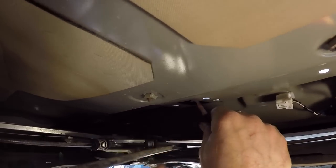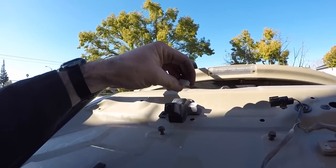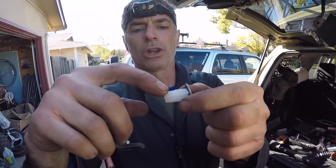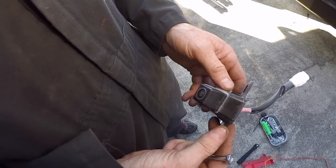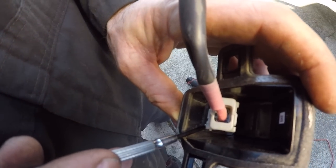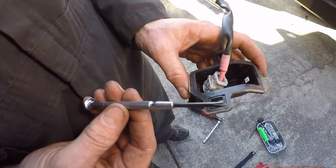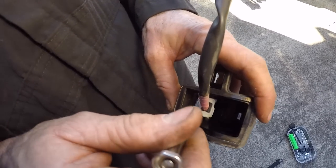I have the camera loose. Bring the hatch down and you can see the plastic clips we removed — this thing pulls out so you can get a better look at the little wings you have to compress on opposing sides so the camera fits through the hatch. Now we have the camera off, but all we want is this piece — we don't want the whole plastic housing. There are two tiny Phillips head or JIS screws inside, one on this side and one further in. Use a tiny screwdriver from a mini screwdriver kit that fits the head really nicely.